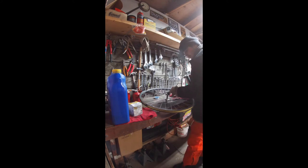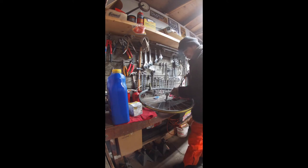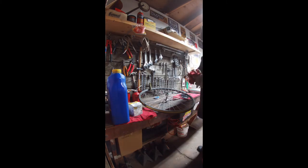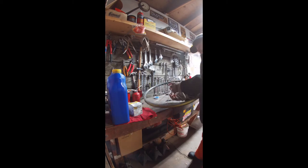We're going to add some grease — just go ahead and put a whole bunch of grease in the general bearing area and have faith that with time and pressure it'll more or less go where it needs to go. I find a lot of people working on bicycles tend to treat every bearing like it's some five-million-dollar aerospace component, but really when it comes to little spinny spheres, it doesn't get much more low-speed and low-stakes than a bicycle wheel used for everyday cargo transportation.